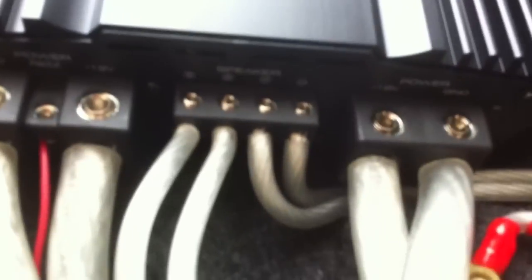On the voice coil wiring, here are the speaker leads. The slave amp's positive is going to the negative voice coil — it's two pieces of eight-gauge wire twisted together into a four-gauge ring terminal. On the other side, I have two pieces of eight-gauge that link across to the other negative — that is the negative side as well. It can get a little confusing.